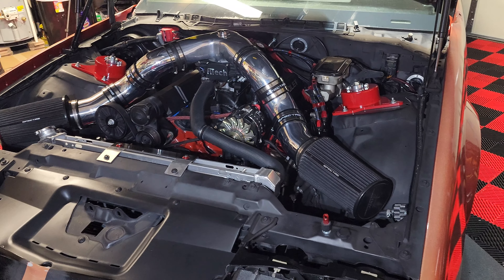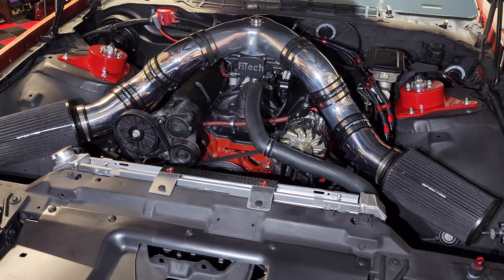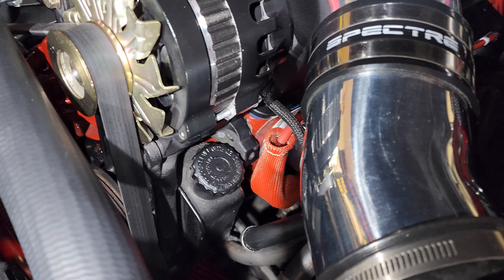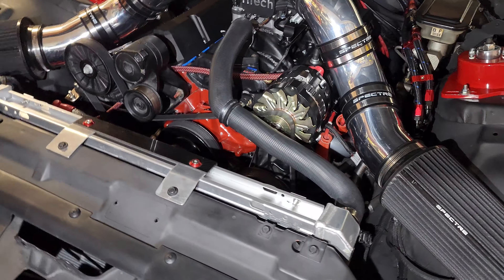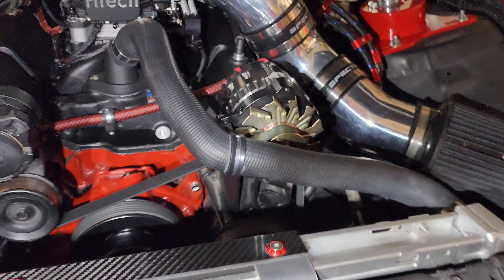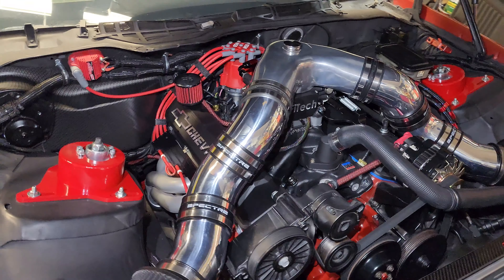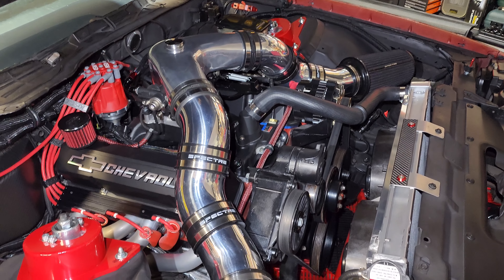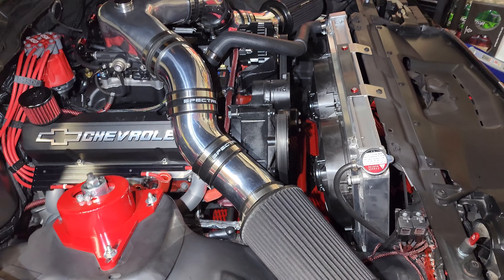While I was letting the rear end drain to get as much of that stuff out as possible, I went through a nut-bolt check on everything — lines, wires, everything looks good. There were a couple of loose bolts: the bolt that sits above the power steering pump was the one that actually backed out and was just sitting on top of it, and then there was one there and above it that were loose. So I went through everything, bolt-checked everything, cleaned it all — everything looks good. Fluids are good, wires, hoses, nuts, bolts — we're good. I'll probably end up doing this about four times a year just to make sure everything's good.